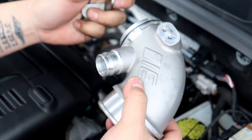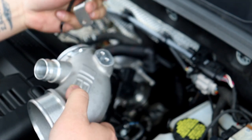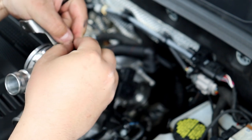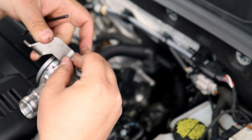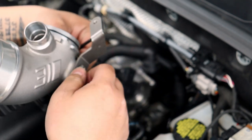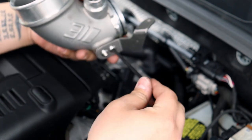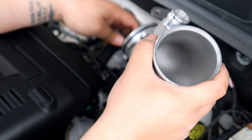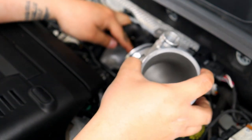Now I have this Integrated Engineering turbo inlet. What we're going to be doing is installing the bracket — there are two bolts, and I believe it's a 4mm Allen key that you'll need in order to tighten down those two bolts to the turbo inlet. Just make sure when you're tightening those two bolts you tighten it as hard as you can so it doesn't back out. Once you get the turbo inlet on and those two bolts tightened, just make sure the o-ring on the turbo inlet is seated properly so it's not going to cause any kind of air leak later on. I like to put the PCV valve on after I install the turbo inlet as it gives a little bit more room.